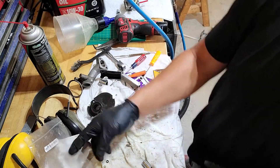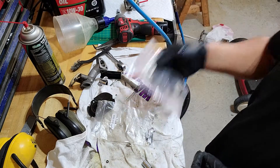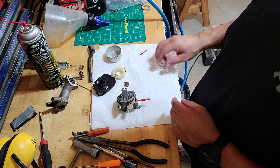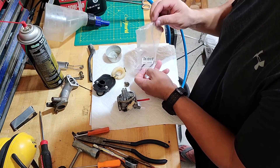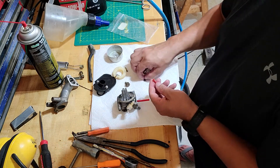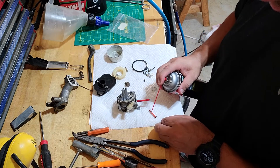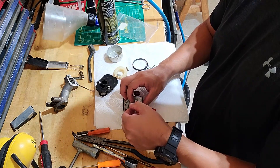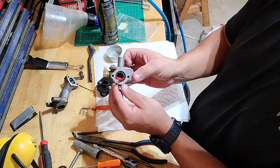We're going to replace the needle. The O-ring comes in this kit. Here's a full kit, and we're going to rebuild this carburetor with it. This is a generic kit so not everything in here you're going to use — keep that in mind. What's most important are these two little O-rings, the smallest O-rings in the kit. You're going to put them over the top of the emulsion tube. I usually put a splash of brake cleaner on them — it kind of lubricates them to push down.